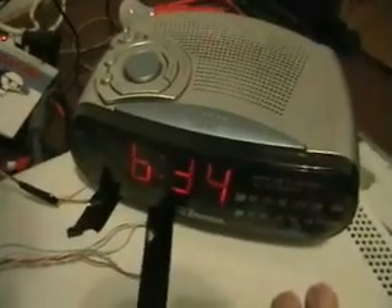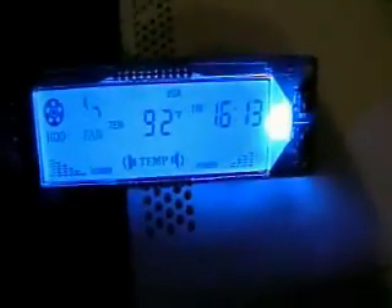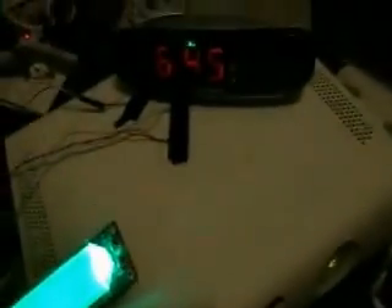A quick idle test here with 30-volt. Alright, now I'll be back as soon as it starts to smell bad, for about 15 minutes or so. Alright, I can't take that excessive loudness and that reeking smell of burning rubber anymore. The GPU's at 92, CPU's at about 86. And I'm going to install the custom heat sink and I'll be back.